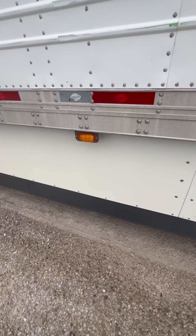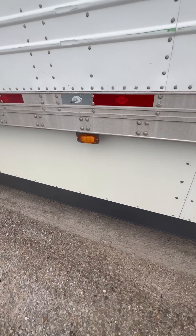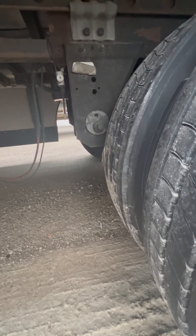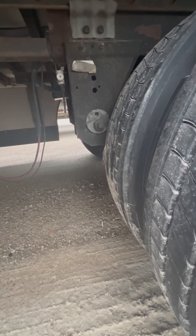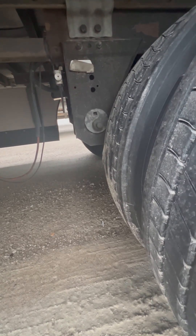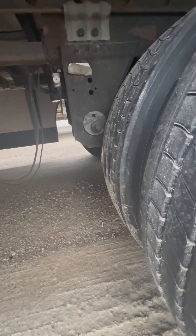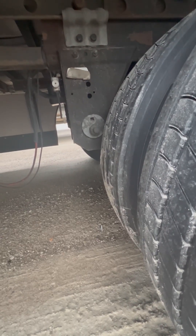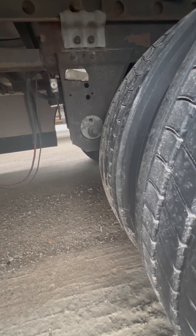I got my marker light, four-way flasher, turn signal, and reflector — I would check those like I did up front. You won't be able to see them, so you'll just point back there. I got my brake chamber, my ABS line, and my brake hose — I would check those like I did up front. I got my push rods, my pins, and my slack adjuster — all properly mounted, secured, not cracked, bent, or broken.